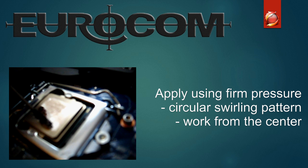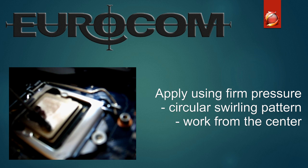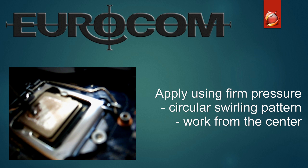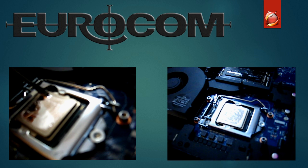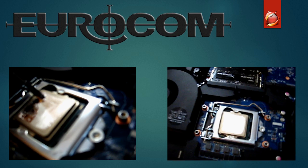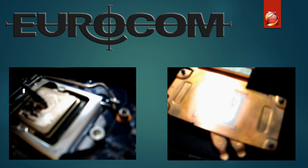As we reach the edge of the CPU, you can see this is producing almost a mirror-like, very reflective finish. We're going to use this exact same technique directly on the copper plate on the CPU heat sink as well. It's important that you do not get this on any kind of electrical contacts or on aluminum — it will cause damage in either case, as it is conductive and will corrode aluminum.